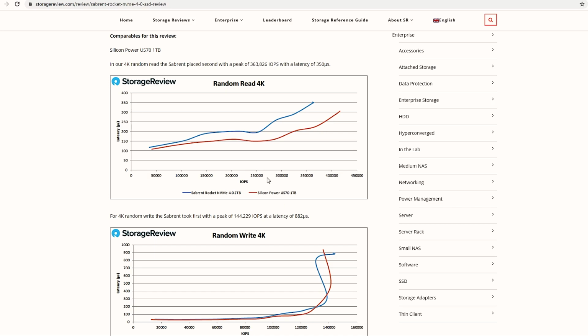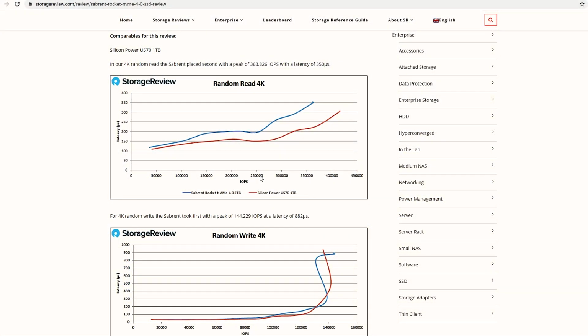Yeah, definitely. So this guy topped out at 363,000 IOPS, and it's a bit under where their marketing claims were. But also, this is a drive where we're not testing fresh out of the box. We're loading the drive up with a full fill, and then we partition off 5% of the drive space and attack that with our VDbench script. So it's a little bit tougher than how certain benchmarks might apply themselves to different workloads. Well, that's a good point, right? Because when we test these drives, you're testing them in harsh working conditions, not looking for those hero burst numbers. Yeah, in this scenario everything's on the same level playing field, everything's treated with the same stressful conditions.